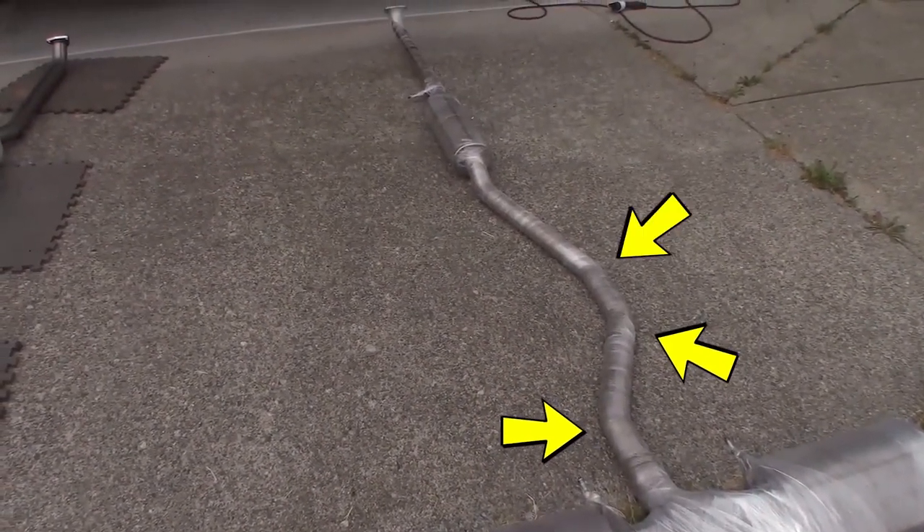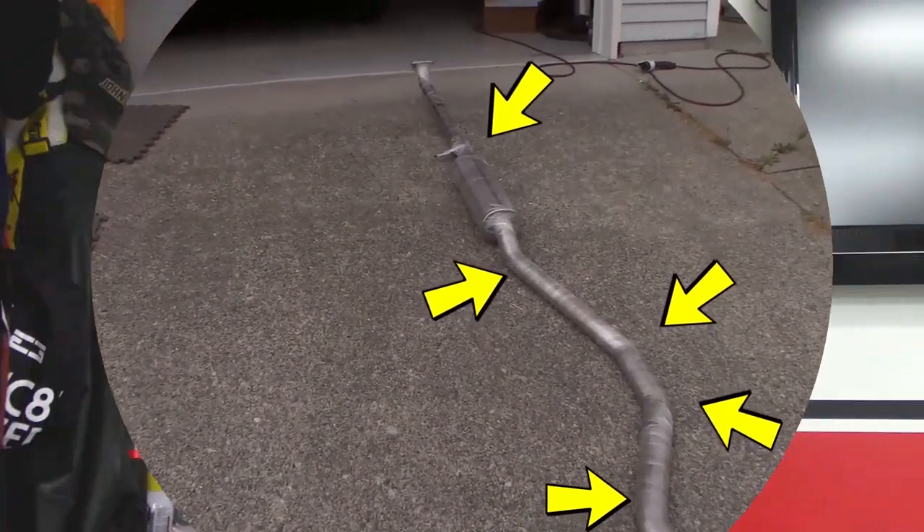A lot of you watching right now might look at this situation as unavoidable because custom car, and to an extent you're right. Aftermarket go-fast goodies work best when paired with an aftermarket exhaust, but sadly the volume isn't the only issue I'm having. Because of its straight-through design, the exhaust system is also generating a lot of drone at certain RPMs. OEM exhausts are designed with a bunch of small kinks and bends to try to minimise drone and volume, but unfortunately each one adds to the overall flow restriction found in a factory exhaust.